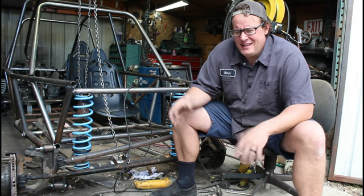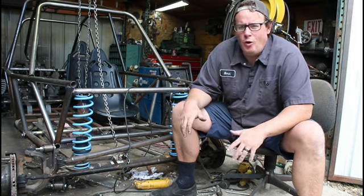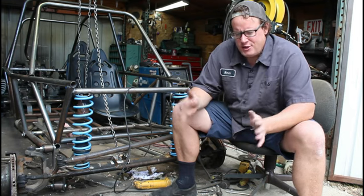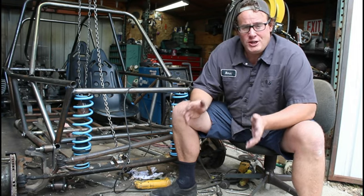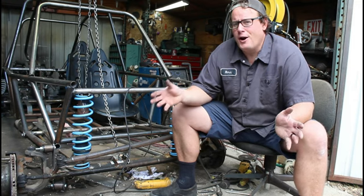Maybe, but you know, I don't know. Who knows? Maybe it won't even be all that much. Because right now, because it moves on an arc, the toe in and toe out factor is a little over 1/4 inch. So that's really only an 1/8 inch per side. Now, is that a problem?